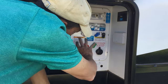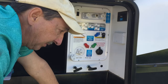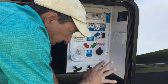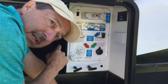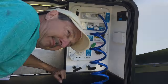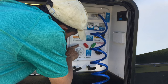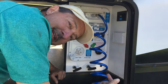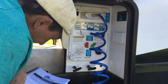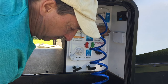Now I've blown out the general lines. Close the valve on the water heater and close the low point valves, close all the faucets, then give it a bit more air. Now switching to winterize: this switch needs to go UP — the manual says to the left, but that bypasses the heater. I want it up. Green one up, white one down, blue one out, and black one out.